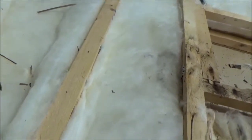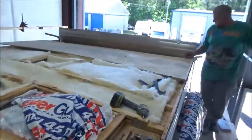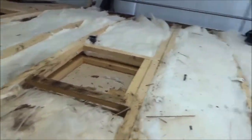So what we're doing now — we originally thought these might have been glued down, but they're not. They just had a couple of screws in them. Like all the others, we're not going to put it down like that — we're going to take the sheathing up, that's what we're doing right now. Taking the decking up. As per usual, we've got to put these in here so it doesn't chafe the wire. There's a little metal piece in there — that's supposed to protect the wire so you can't put a screw through it, but they don't seem to protect the wire itself. You can see there's some rust on this wire already right there. So we're going to put those little red heads in there — those little plastic pieces — and we'll check it all throughout the roof.